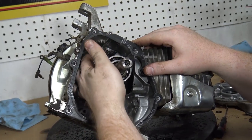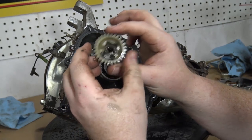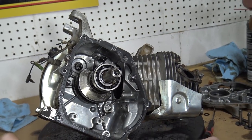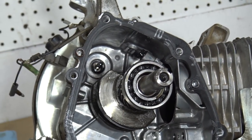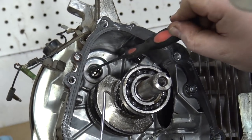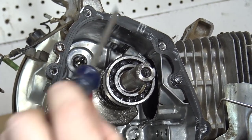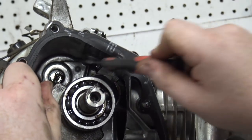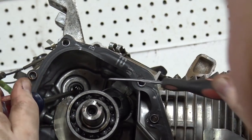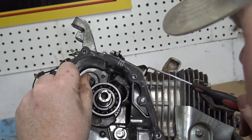I'll get this gear cog out, it'll slide right out, and there is a washer behind this gear cog. Once you get this out, make sure you get that washer. And when you pull the governor arm out, there's also a washer on top of the block. Make sure you get it as well. Now this washer can be a son of a gun to get out. Sometimes I've tried different tactics. A magnet works best, but what happens is oil creates like a little seal on it and will not let the thing get out. I've spent 15-20 minutes trying to get this freaking washer out before.